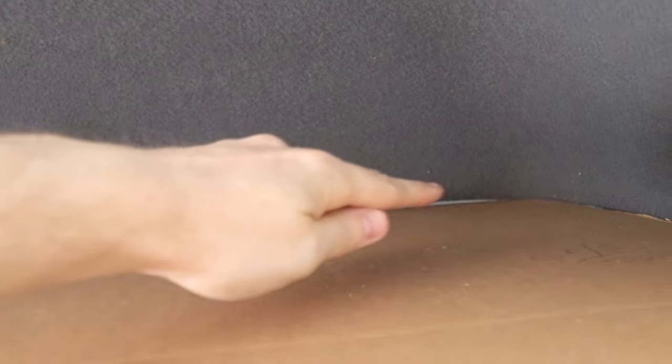With these gaps, we thought that it's because it actually goes backwards like that, but actually it's a bit of an optical illusion. This side here is actually higher than that part, so it's not that the gap is backwards, this actually goes upwards. So what we're going to do is leave it almost as a semi-deliberate air gap for stuff that is stored in this compartment here, and that way we get a bit of airflow, so nothing goes moldy at the back or anything like that. But yeah, that worked well, and we're now going to take it over to the plywood and cut it out on the plywood.